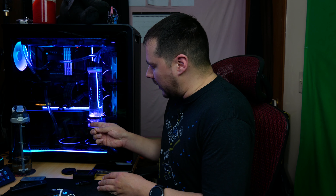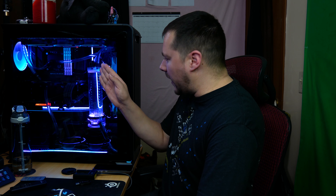I also have a fill port coming out of there. The really nice thing about this pump-res combination — what I really like that EK did — is the multiple inlets on the top of the lid, as well as another one at the bottom, plus the ability to have two different outlets: one for the main loop tube run, and another that leads to what you can set up as a drain port. It gives you one more option if you want to use a squeeze bottle to fill the loop, or as I did, set up a fill port that goes to the top of the case.